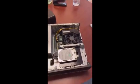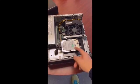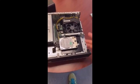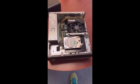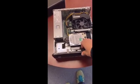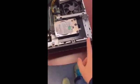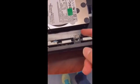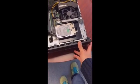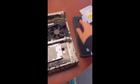Usually the machine will already have the hard drive or SSD already connected, as well as the face panel and all the other components on the inside. The first thing we want to do is remove the face panel. There are four switches here that have arrows indicating where to push them — please do this gently so you don't break the face. It will come out really easy. You can leave it here for now.